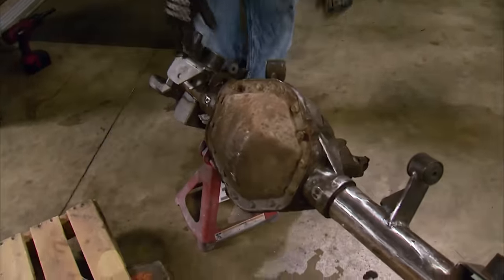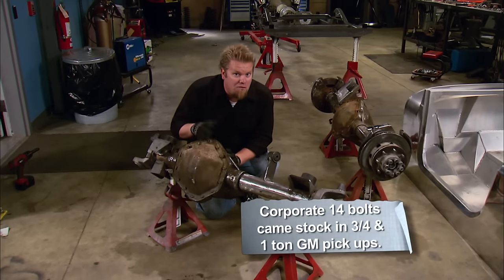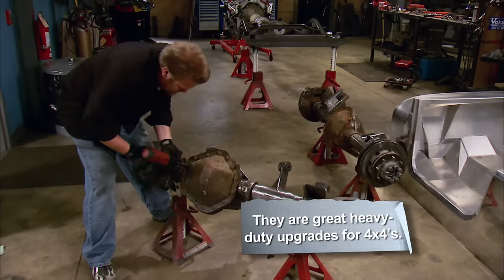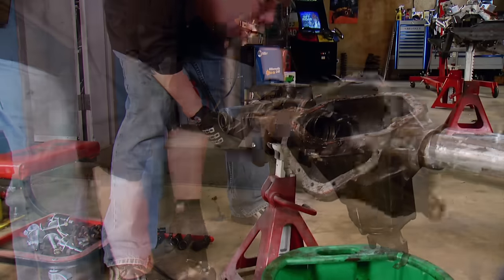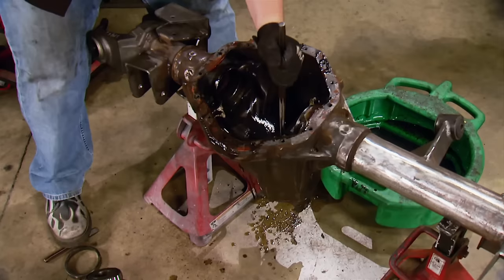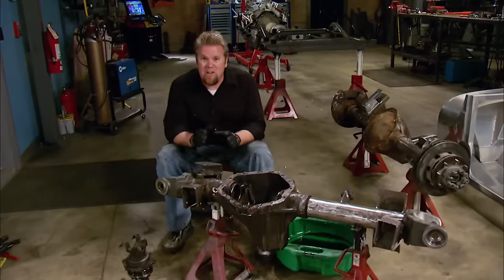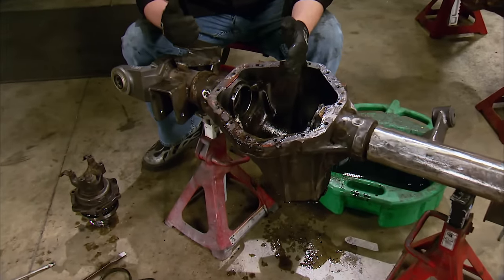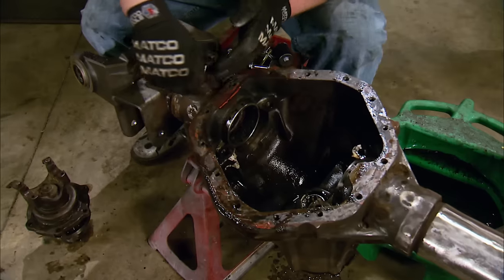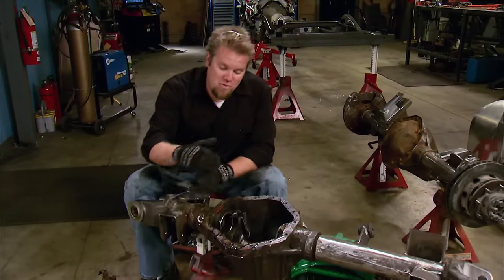There's one thing we want to spend some time talking about, and that's this front axle — nobody has ever built this axle from a manufacturer. There are some issues when you're building a hybrid axle like we have here. The most important is how to seal the axle shaft itself. This is a rear axle assembly that we converted to a front axle. The front axle has a seal at the center section designed to keep fluid inside but not allow it to flow down the tube. On a rear axle, you actually want the fluid to flow down the tube because it lubricates the wheel bearings. There are a couple of ways to convert this rear axle into a sealing front axle — you can drill out the spot welds, press the axle tubes out, and press in new ones machined to accept a Dana 60 front axle seal, but that's a lot of work, especially in just a two-car garage.